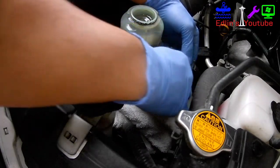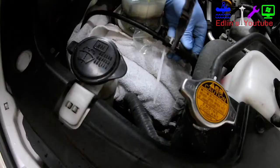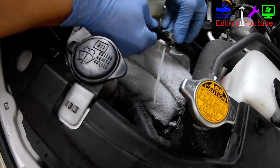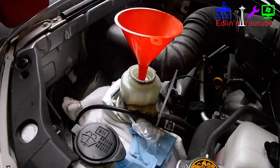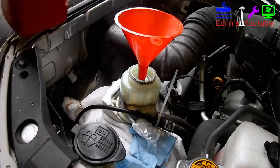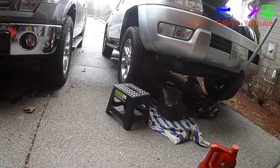Now that it's disconnected, cap off the nub so when you put in your transmission fluid it won't come out. Here's your return line — make it nice and tight so nothing will drip. Now add your Dex 2 or Dex 3 automatic transmission fluid for your Toyota vehicle.